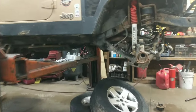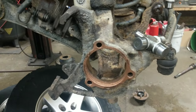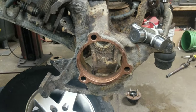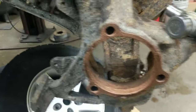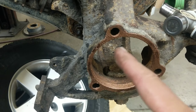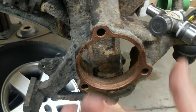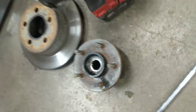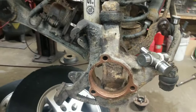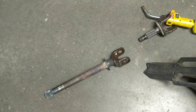Here the TJ is up on the lift. I got it all pulled apart — wheel bearings out, brakes off, axle shafts are out and I already got the one all pulled apart. A little side note: I always clean this area up nice and good and always anti-seize the crap out of it, because those always come out real hard and we can help the next guy get this bearing out of there. Might as well, right? So let me take you over here to this axle shaft — this is the long side, I already got the short side all apart right there.